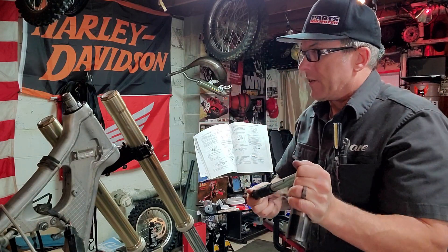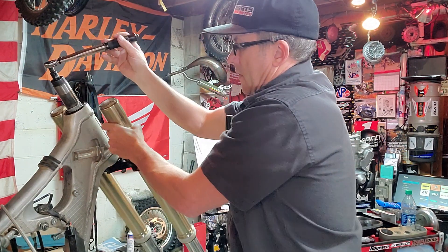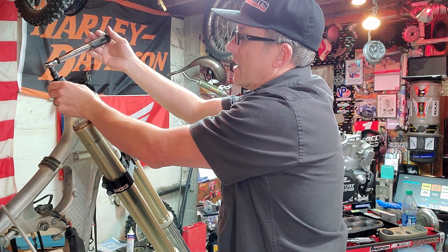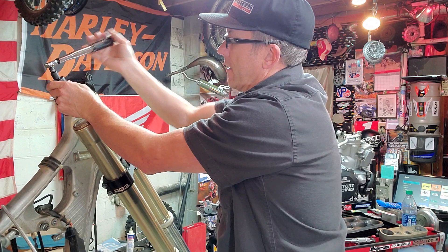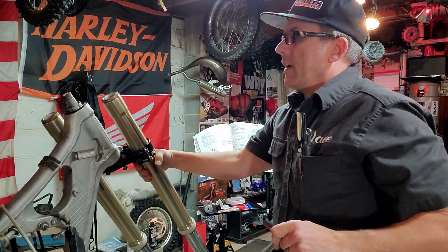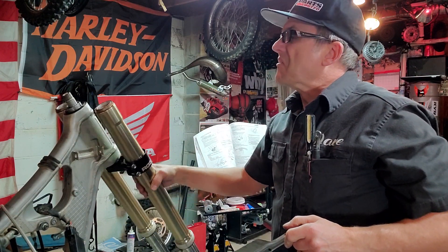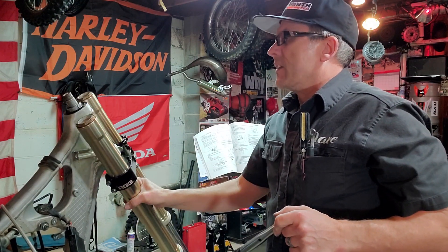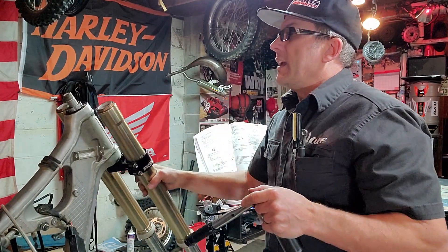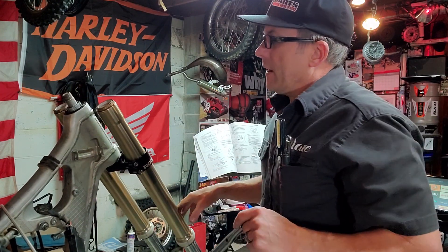Not very tight — remember that. This does not need to be all that tight: 5.1 foot-pounds, or around low 60s in inch-pounds. Bring it around, listen for the click — right there. That's all there is. It's really only about a half a turn past hand tight. It might feel just a little sluggish, very little, especially if they're brand new — new races, new bearings, new grease. It might feel slightly sluggish, so don't worry about that.